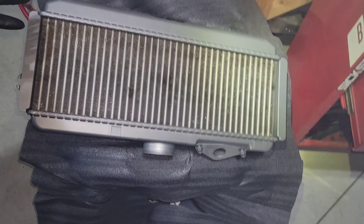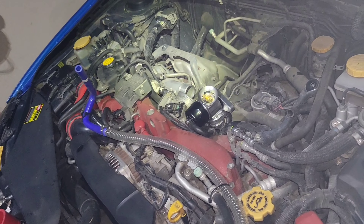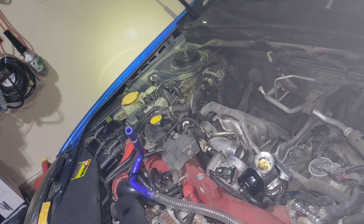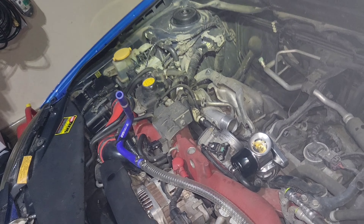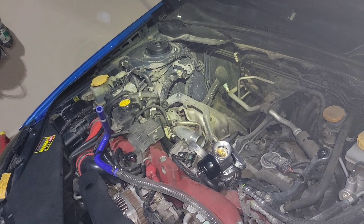Here's the new - well, not new but Cerakoted - intercooler. You can see it's all beautiful, the pipes on the back are all done, which should help with extracting heat. There's the old one - this thing was full of oil, more so than my blob eye when I first got it. I cleaned it all up and you can see it dripped right there. It might be turbo seals, might be a clogged PCV system, because the metal tube was all clogged up and it was pushing it all through that secondary PCV system. These cars have a really bad PCV system as they get older and people don't maintain them - I have another video on my channel that shows that.